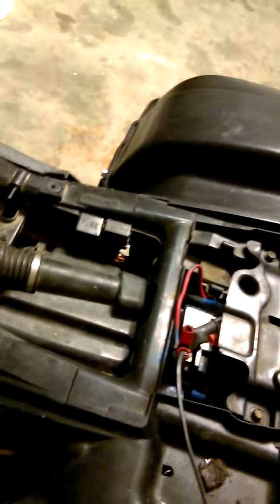The point is I'm a little stumped on this four-wheeler because I even went to a Suzuki dealer and asked them, and they were telling me it could be the wiring harness. It could also be the fuses. And I took it to the cycle shop and they said that it was the stator, that it has to be the right stator for a specific model. He asked if it was not having spark before when it was running, and to be honest, it was one of those scenarios where the four-wheeler will start and it'll have its days where it won't want to start.